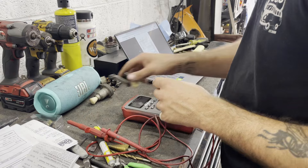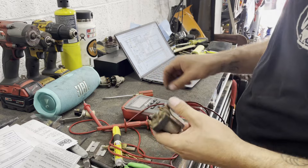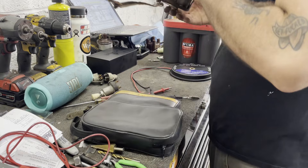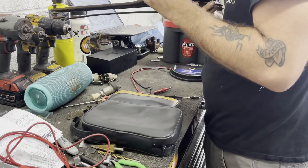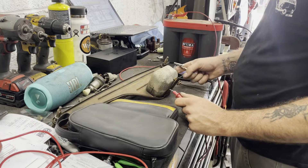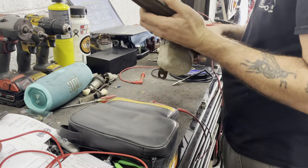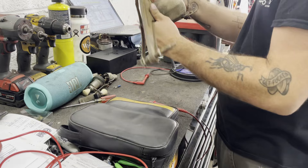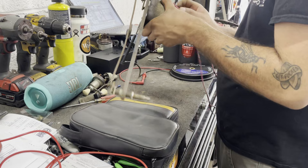Now that I have a working wiper switch, I should be able to bench test the wiper motor as well, assuming I have a good six-volt battery. Let me try to set up a bench test for the wipers. I've got my ground and a six-volt battery. The terminals look like 31B and 53A. I tried that — it shorted out on that one, but the motor won't spin.